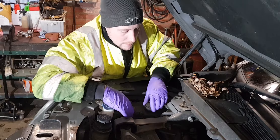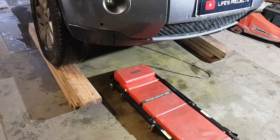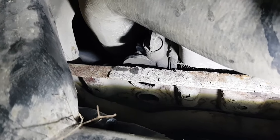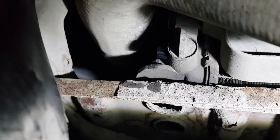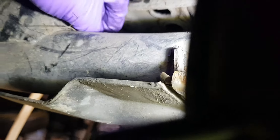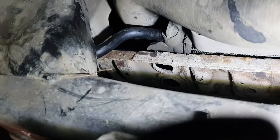The first thing you need to do — especially since I've just driven up here — when the engine warms up it creates pressure in the cooling system. There is a little drain on the radiator, and if the system's pressurised and you pull the drain it's just going to splash everywhere. So first, release that pressure. My top tip is then to screw the cap back down so it creates a vacuum — when you release the drain on the radiator the water doesn't come gushing out. You can control the speed of the water with the cap: let a little bit of air in and it drains slowly; take the cap off and it starts gushing. I've put the front of the Freelander on some wood — it's nice and safe and allows easier access underneath.